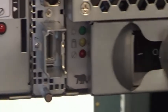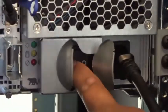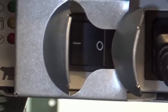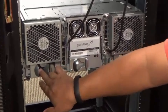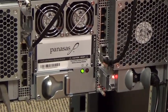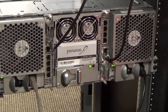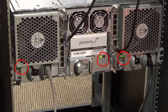Once we plug the power cables into the wall, we'll come back to the power supply units and flip the toggle switch to the on position to power the units on. Once the power switches are on, you will want to pay attention to the LEDs. If power is working, you should see three green LEDs as shown.